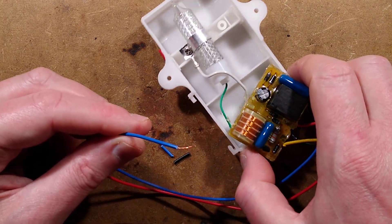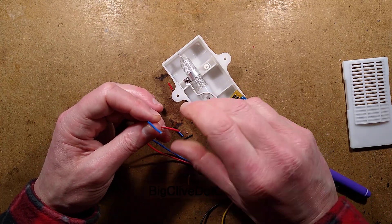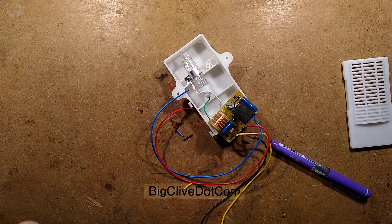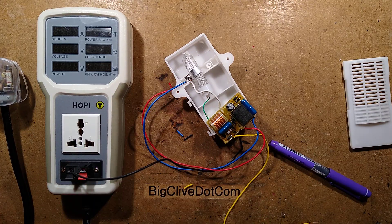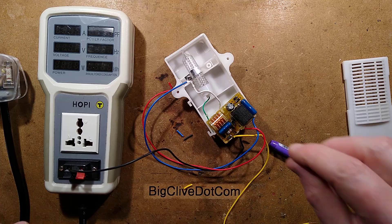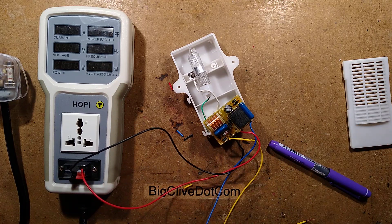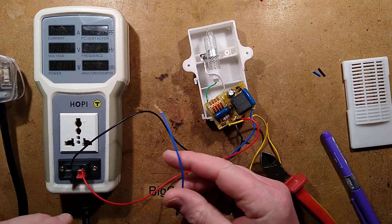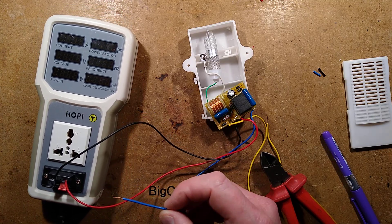Either way, it does have mains voltage in it — 240 volts in the UK, 220 volts in China. I'll twist these wires and stuff them into the hobby supply as a convenient connection point. I'll put the black, which I believe is common, into neutral. I reckon blue is the load and red is the live, so let's put the red in. When I power this up, I'm not expecting anything to happen because there's a relay contact that is open. I'll keep the blue handy because I'm going to emulate bridging the contacts by tucking it into a connection.